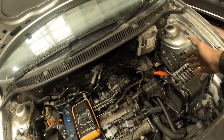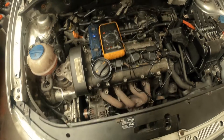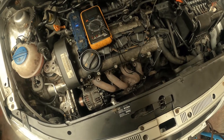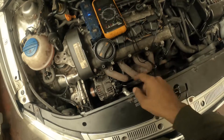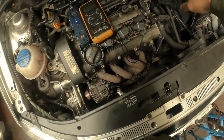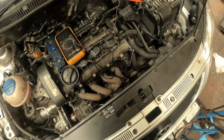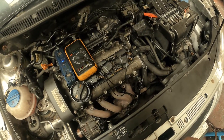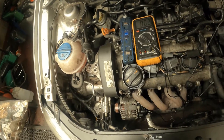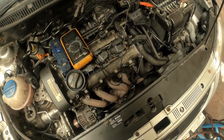Always check your continuity between the two. On this one the alternator had been replaced because nobody checked for grounds. When you're testing, you should normally get 14 volts at the back of the alternator, or around about there, and you should get the same on the battery. If you're doing a continuity test, make sure the car is switched off before you do it. And obviously we can see here we've found the fault. Sometimes people would just swap the alternator out before checking, just like how the mechanic had done it, but we figured it out.